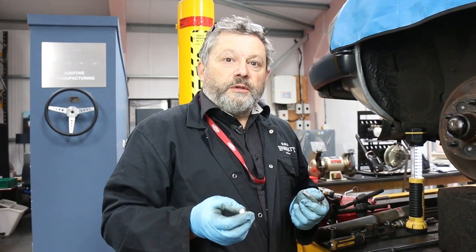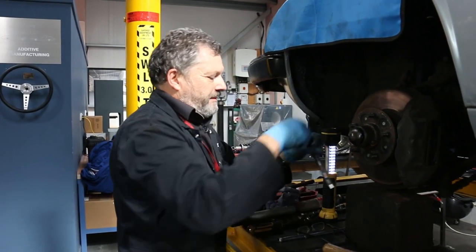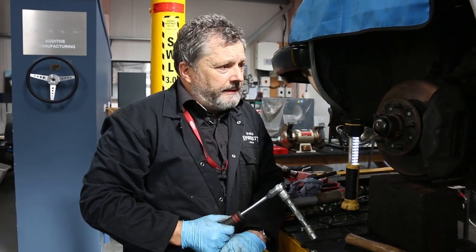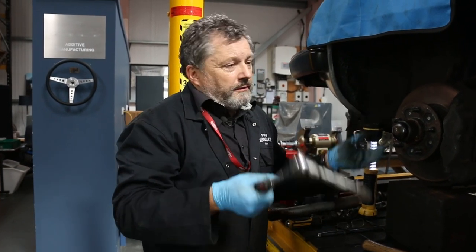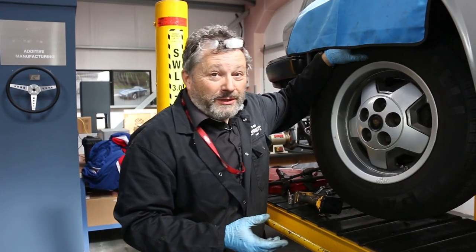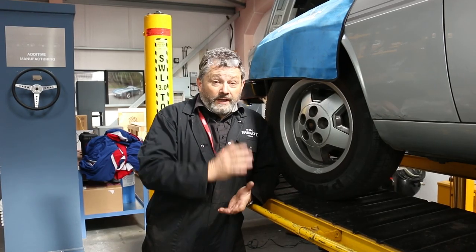Going in with the new nut and bolt as we did before, and that's it — everything will be bolted up and we're good to go. Just the two mounting points, put the wheel back on and we're good to go. A lot easier than changing the rears. Obviously we're going to change a pair, and again just make sure the car's well supported — it's a heavy car, you don't want it trapping your fingers; the last thing you want is to have it on your head. Finish off with a torque wrench to the correct spec. Thanks for watching — don't forget we're giving this car away, so look out for that golden ticket. Keep an eye out for the next video where we'll be fitting quad halogen headlamps.